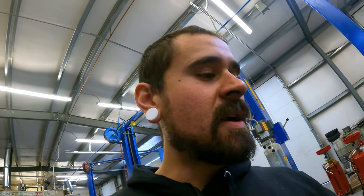In this repair area, say you might have something like this on your bumper cover, I actually feathered it out to 1200 grit, and I sanded the primer itself with 1000. So I never used anything very coarse on this. Even these scratches on the outside look weird because they're a slightly different color right there, but they're only 1200 grit scratches. So when I seal that, it's going to cover all that just fine. It won't leave any weird scratch marks in the sealer, so everything looks nice and slick and smooth, and that silver is not going to show any weird texture.